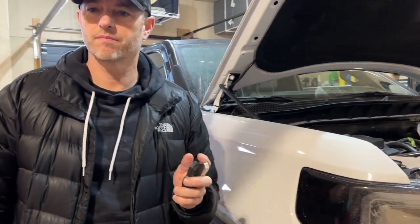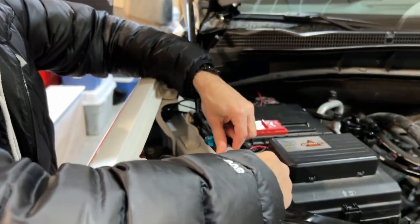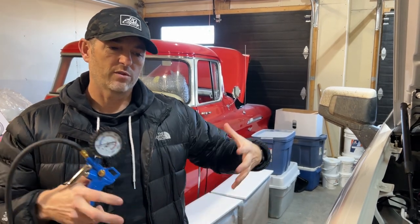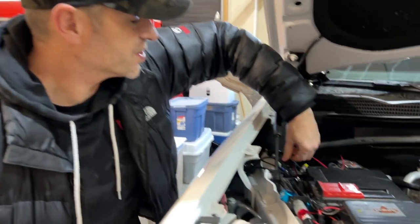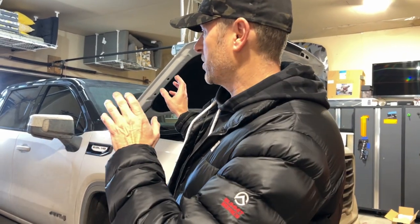I can also let the air out with the remote — so back to the minimum five pounds. And of course, because we had an air system on board, why not add an auxiliary fill? I have a video on that too. It lets us fill up soccer balls or maybe a low tire, though it's not very efficient since there's no reservoir. With a simple switch of this knob we isolate the airbags from the rest of the system, and then the compressor fills it up to 100 pounds.